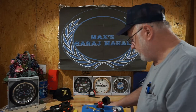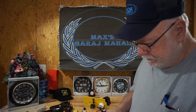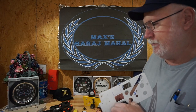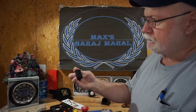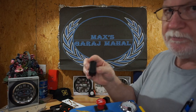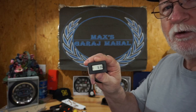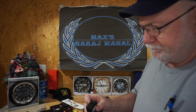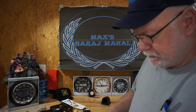All we need now is to incorporate the hour meter and the voltmeter, which I've got to get back out of this panel. I want to put it back in for you guys to get an idea of where it was located at on ergo number one. This is a blue LED lighted voltmeter, and I'm going to put it right here. I'm going to put the hour meter — which shows 63 hours on the mower — right in here as well. I should have left the analog one in until I got to 63 hours, but I'm going to go ahead and put the original 63-hour hour gauge back in.